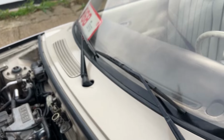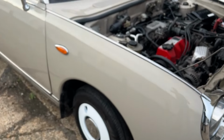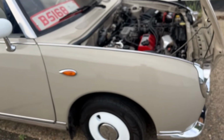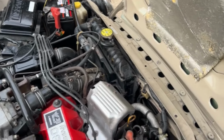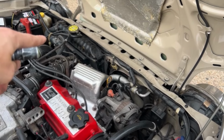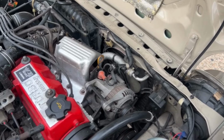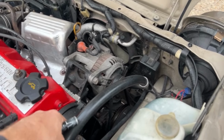This is a left-hand drive conversion from right to left. Where do we go further? Radiator starting to oxidize at the bottom section. Radiator bottom section is not secured. There's water in the radiator. It needs the coolant, the antifreeze. All three belts cracked. Advised the timing belt be replaced.